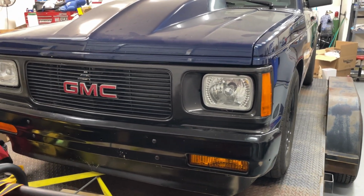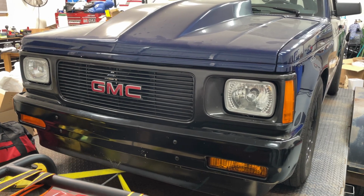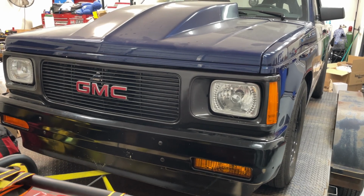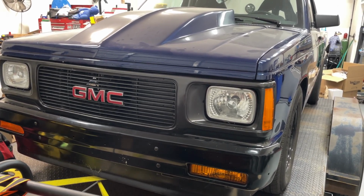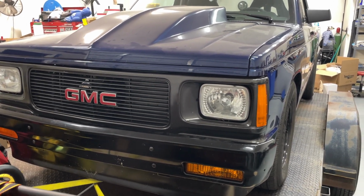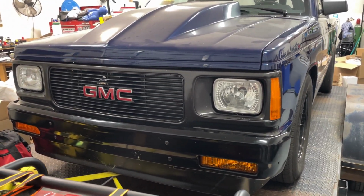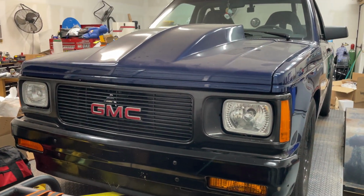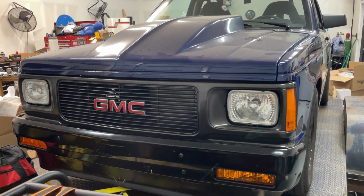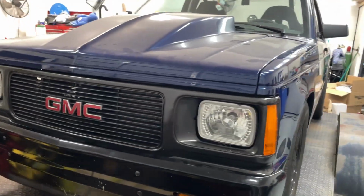The point of the chamber softening video is that the chamber softening itself was to help with both those situations. So that's the biggest reason for it. Even though I might have used the terms wrong, the idea of the chamber softening, and the reason the burn happens the way it does, is to hopefully prevent both of those. But anyway, I will say I was wrong about that. It's not caused by colliding flame fronts, and pre-ignition is different than detonation. And the pinging sound isn't from the colliding flame fronts.